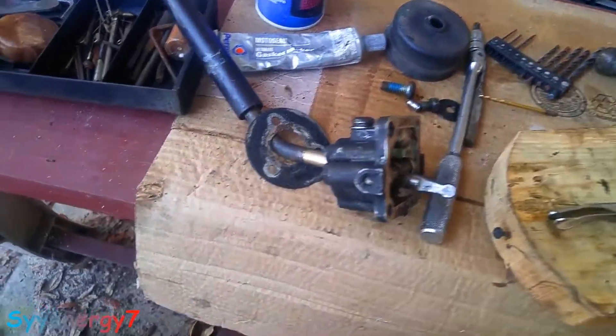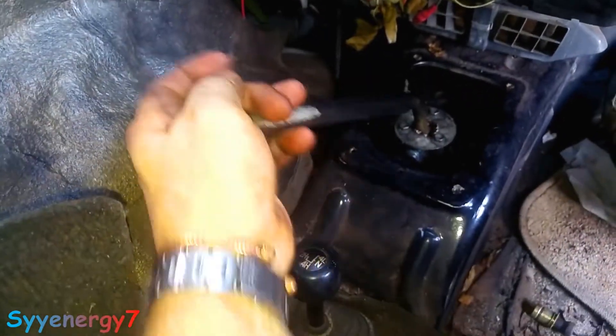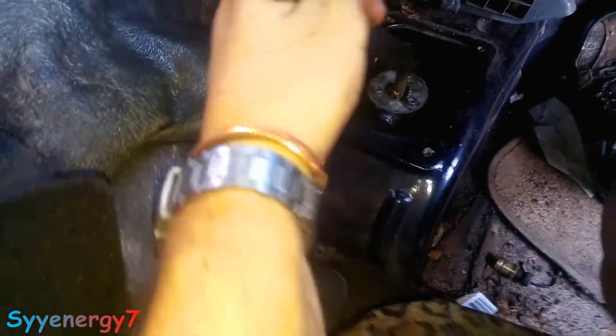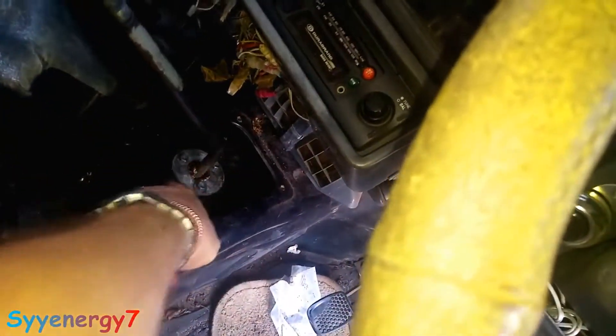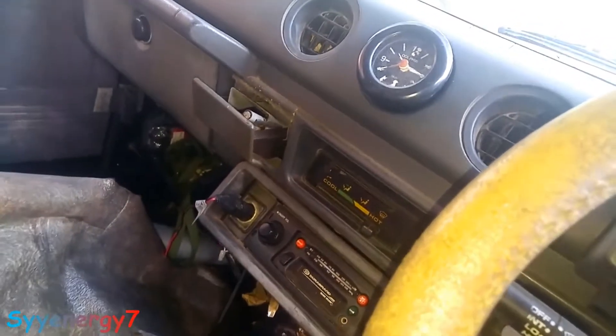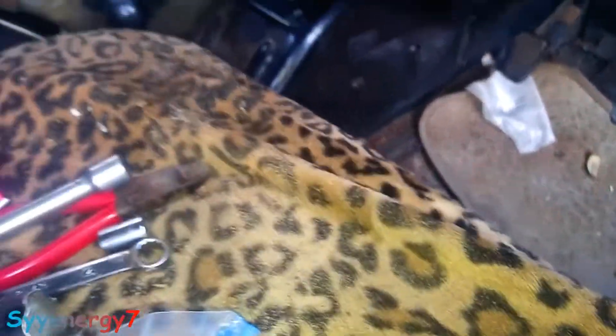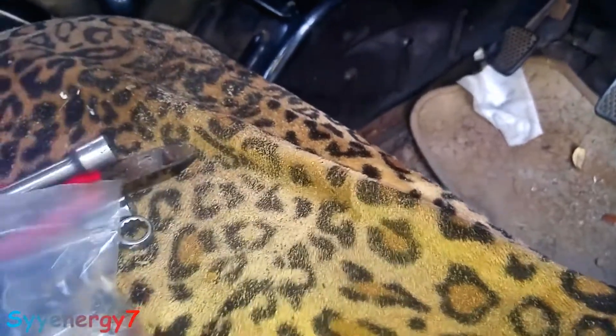You should change that as preventative medicine — this one bolt right here and that bushing on the top. Checking it now, it shifts nice and tight with hardly any play back and forth — third, fourth, fifth, reverse — nice and tight. It's better than it ever was because of that bushing too. I put Loctite blue on everything. I didn't torque everything with a wrench, but you don't want to tighten down these bolts too tight with aluminum — I know about what to do.